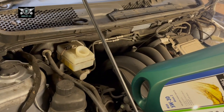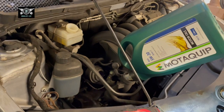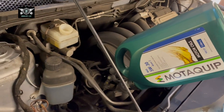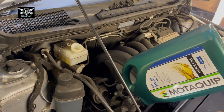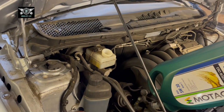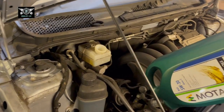Now I'm going to get the car up. I already removed the front wheels because I'm doing a general service to the car anyway. We're going to tackle the pads, so that's all we need to do: get that cap off, check your fluid quantity, then get the car up and remove the wheels.